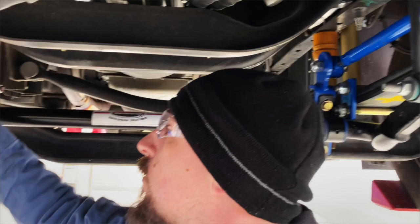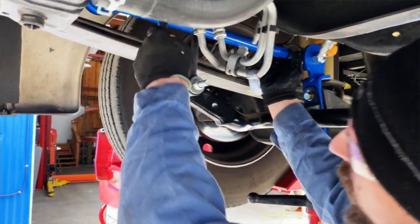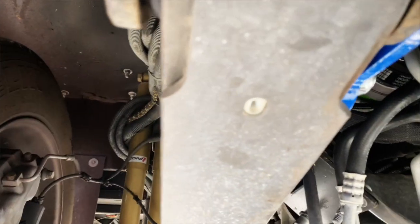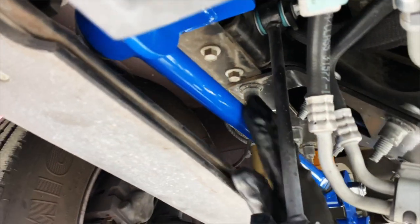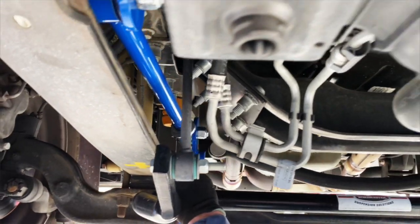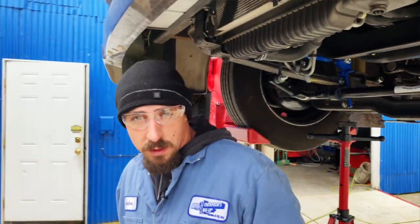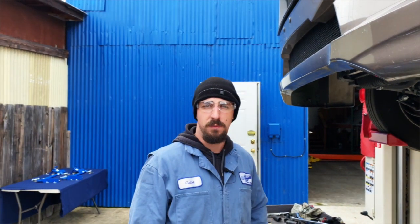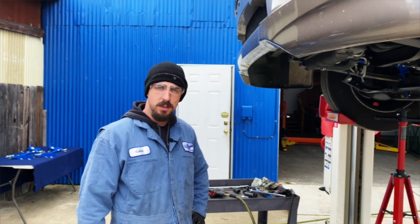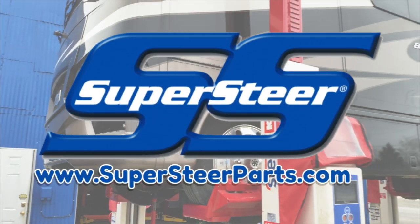As you finish up, look over all your brackets to make sure everything is sitting flush on the frame, your bushings are sandwiched with flat washers, and your radius rod is on the outside of the brackets so you have clearance with the sway bar end link. That concludes the installation of the SS403 radius rod kit for the F53 16K to 26K chassis. From Henderson's Lineup, we wish you safer and happier driving — see you in the next video.